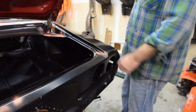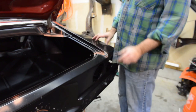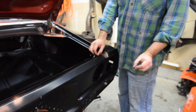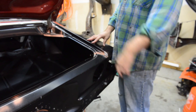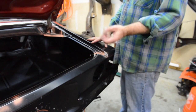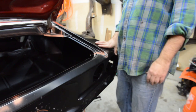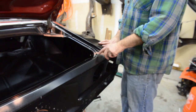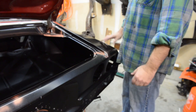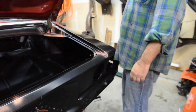So, go pop the clamps off of here, maybe lift this up a little bit. Get my Dremel because it has a small blade on it and gives a real fine curve, versus my 4.5-inch grinder with a cutoff wheel, because that's got a 1/16-inch blade, and it's just going to take out too much material for where this particular area is. So let me get this stuff off, time lapse set up, and all right, enjoy.